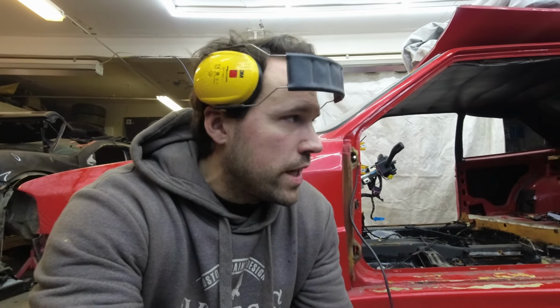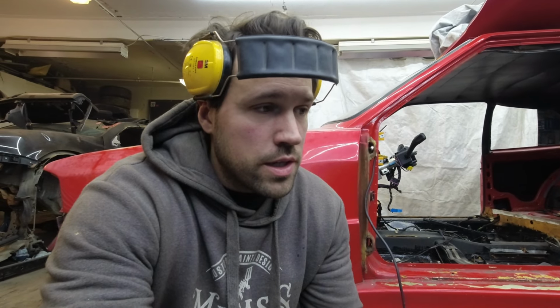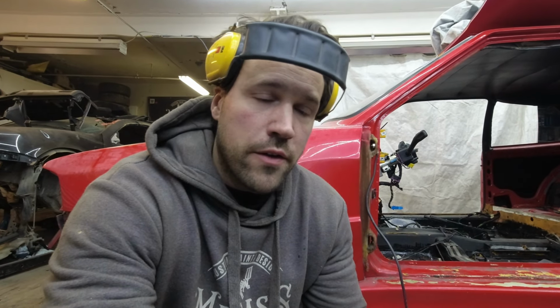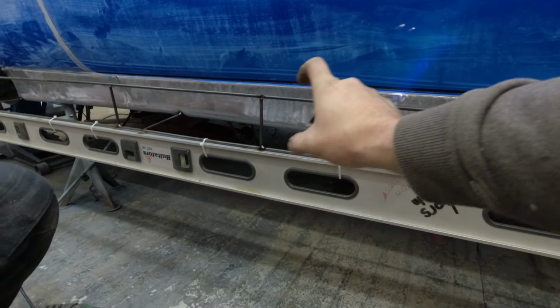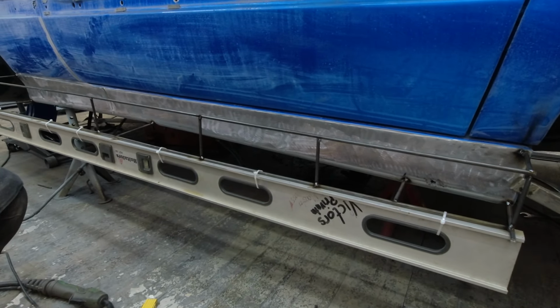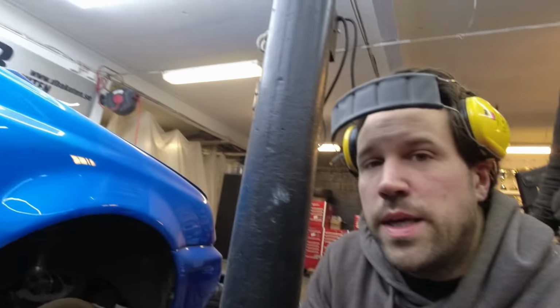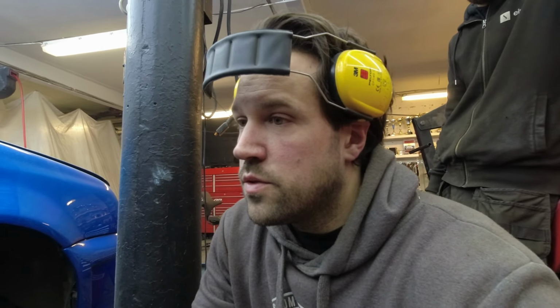During the years that we have experienced, me and Rosendorf, is that if you use the whole side of the panel and not cut up in like 10 slices, you're gonna get so much less welds, and you're gonna have so much easier to do your prep work for paint. So some people, they use like a little sheet here, the next sheet, the next sheet, and next sheet. You have so much weld, and you create so much heat and tension into the panel, and that's gonna make your life really hard in the end when you're gonna prep for paint to get everything straight. So that's just a tip for you.